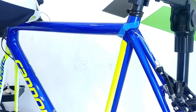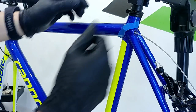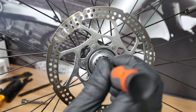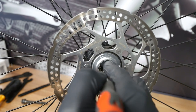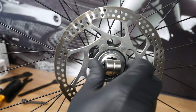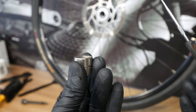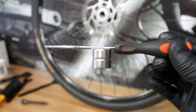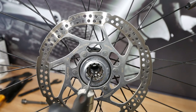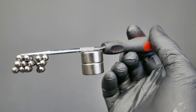Our magnet isn't going to rest yet — we have trick number four: the pick and the magnet. If you need to remove ball bearings from the bearings, using the magnet itself isn't very handy if you don't want to just shake them off the hub, because you don't know how many balls are on each side. You can buy a very expensive pick that's already magnetic, but this hack is so handy and it takes lots of balls — it's very strong.